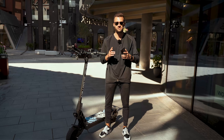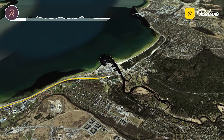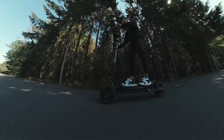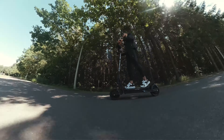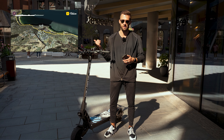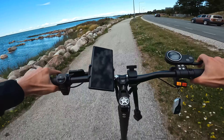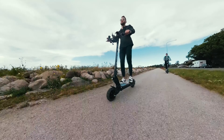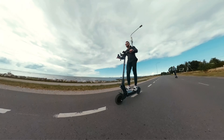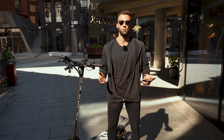Here is the result of our range test of the Yumi M10: we got 50.2 kilometers, which is about 31 miles. Our average speed was around 35 kilometers per hour, or about 20 to 25 miles per hour. We were using dual drive all the time, second or third gear, and of course the power start — so those were not the slowest settings, very far from that. We're quite happy with the results and believe it was a really fair range test because we had a lot of stops, accelerations, and distractions, so that's pretty much what you can expect in real-world conditions.